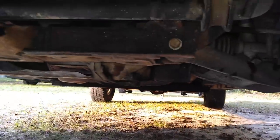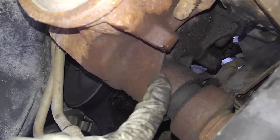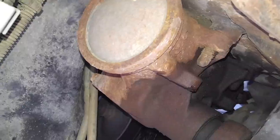The starter sounds good but the steering box sounds nasty. I had a fellow over here with a Mercedes diesel and he was jiggling the steering — you could hear the box go clonk clonk clonk. Two hundred and sixty thousand miles, close to five hundred thousand kilometers. The bushing in the bottom is worn. It's not a huge job but it is a job — pull the steering box, take off the pitman arm or the center link connection. Maybe I'll just go to the junkyard and get a low-mileage one.